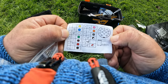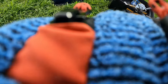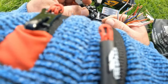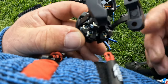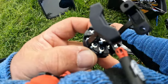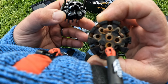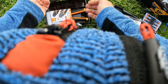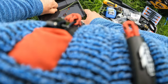There's a diagram on it showing how it all goes together with the keyways, and it's even got a basic wiring diagram telling you how long to strip the wires back — four to six millimetres. In most cases you would literally just insert the wires into the terminals and screw them up. One of the great things about this plug is the terminal numbers are written clearly on it, which is a big help.